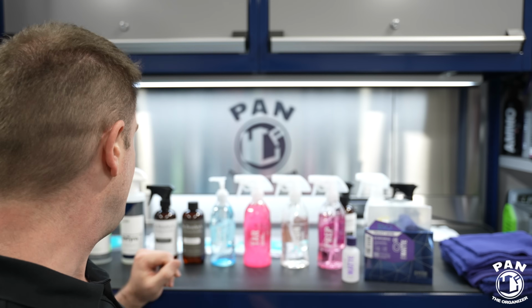So do not apply any waxes, silicones, that kind of stuff. No glossing agents, no polishing the paint. You're not going to clay the surface either. Don't forget the clay bar is an abrasive, so you can potentially scratch the finish a bit too much. If you do have a bit of contamination and you want to use a light duty clay bar, be very, very careful. Test on an inconspicuous area first, but normally use the chemicals for decontamination.